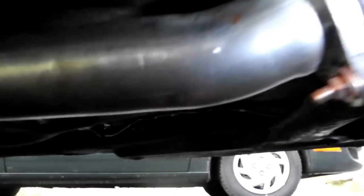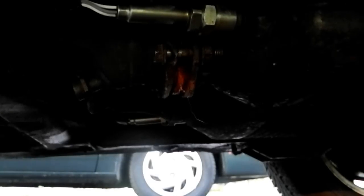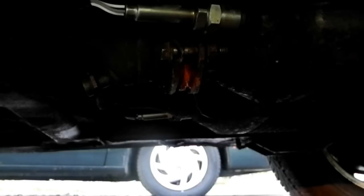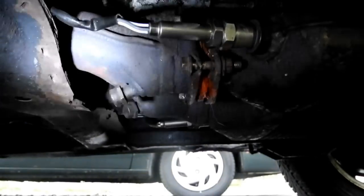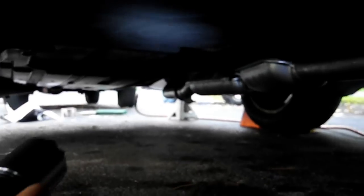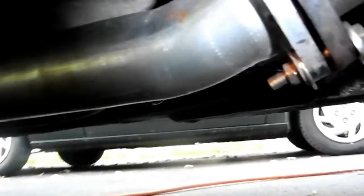I don't see any smoke coming out of this joint here whatsoever. And this one here was another suspect — I don't see any smoke coming out of there either. I'm going to get a little more pressure on the compressor. You can hear that compressor kick on. And I can see the smoke pulling out the tailpipe out there from the rear of the car. I don't see any smoke getting up in here until it gets up there, and that could be coming out of the tailpipe. These two joints look solid — I already checked the front, and there's all the smoke in here.